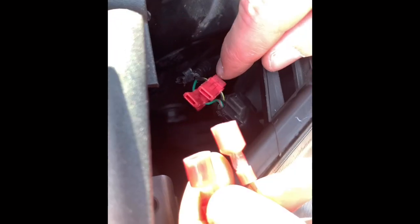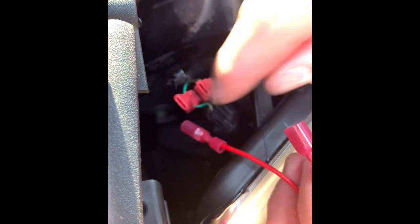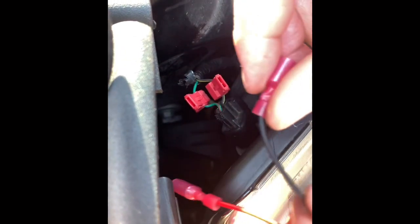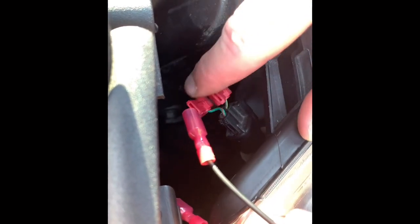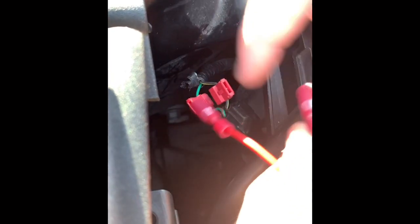We made these two clips and connected them to the existing running lights. Now we're going to use our connections and just plug them in. Make sure the red is going to your green-and-red wire, and the black wire is going to your black-and-yellow — at least that's how it's set up in my truck; they might be different depending on the year, but typically black goes with black and red goes with red. Give it a good push all the way down to the base of this connection.